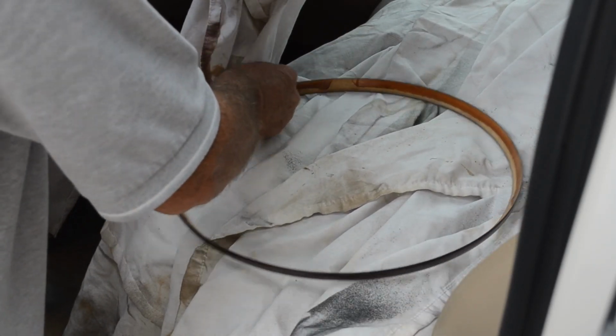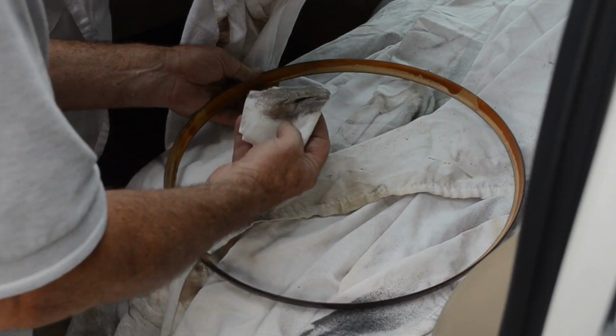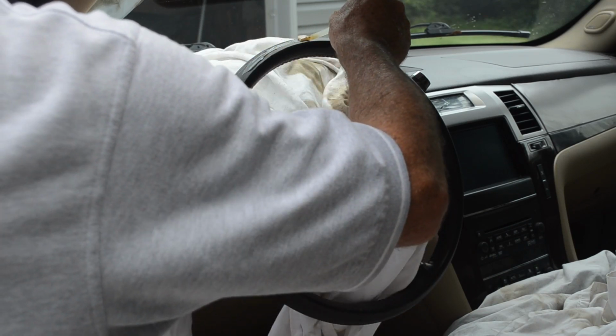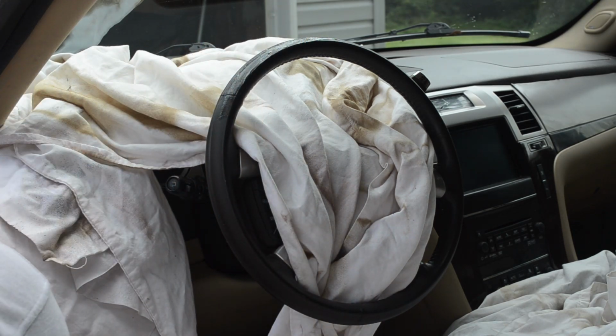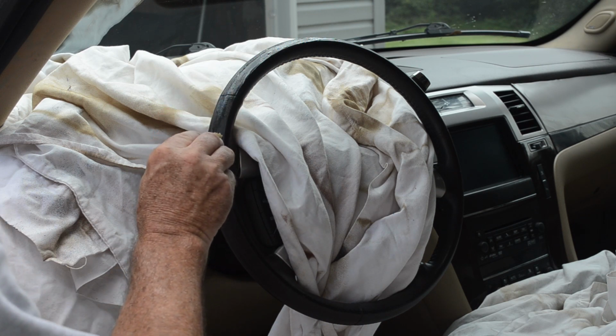If you don't get the mess out, you're not going to get any kind of adhesive, I don't care which one it is, to do the job. This is all goo on the inside. I'm using contact cement here with a brush and just putting the glue where it belongs, where that channel used to be. You can see that.